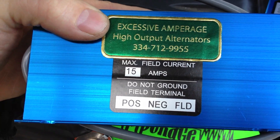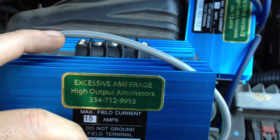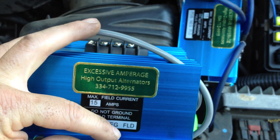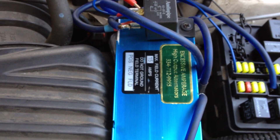What I did on this one: I come off of the same ground source and I'm running this to the negative side for the adjustable voltage regulator. As you can see on this one, there's positive, negative, and field. These labels right here coincide with the screws — you've got a positive label, that's your positive screw; you've got negative, that's your negative screw; and here's your field screw. So we're going to show you how to wire this through your voltage regulator.